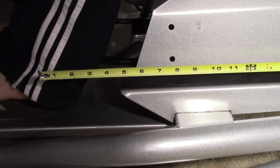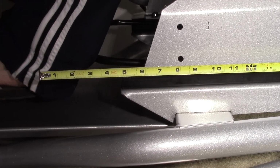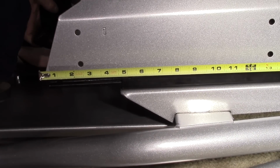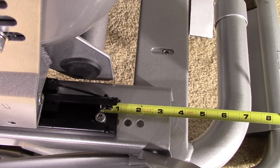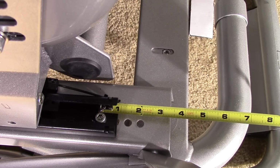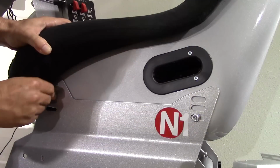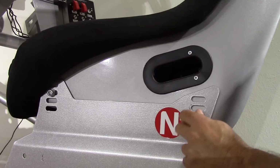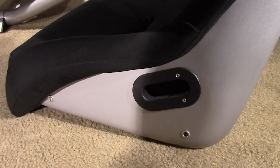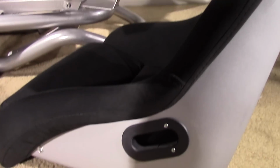The seat then has its own adjustments, starting with seat sliders, allowing for about 6 inches. In addition to that, there are 4 different holes to mount the rails to, offering another 2 inches of adjustability front to back. There are also 4 different slots on the front side of the seat mount, and 3 on the rear, offering several different mounting angles. The seat angle is fixed, and there is no adjustment for that angle.